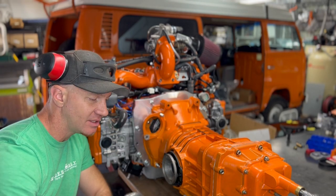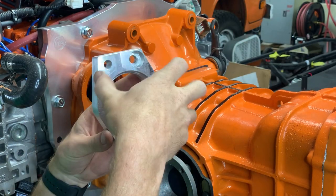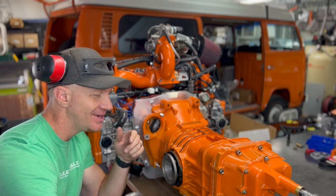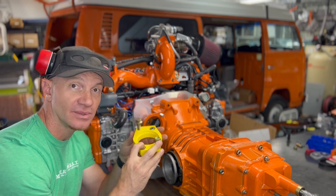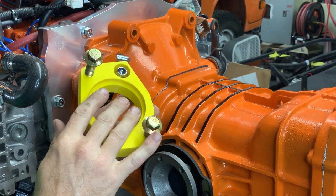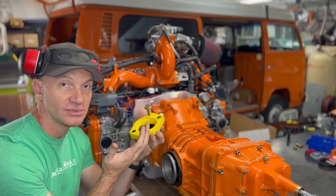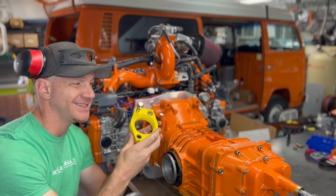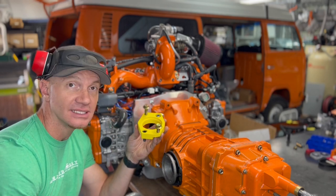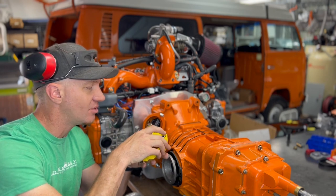So yeah, we started with this one, and it didn't work. Next up was this one. It actually worked, but we still wanted to clock it a little bit more, to get a little more clearance there. So this was version 2. Then to save some costs, we did a 3D print of that guy and tested our 3D print. We used 100% infill on this, and it is strong enough to actually test the starter. Honestly, it could be strong enough to actually run, but we wanted to use high quality CNC'd aluminum. I believe this is 6061 aluminum, the good stuff, the stuff you want to use.